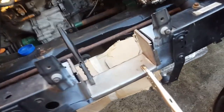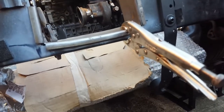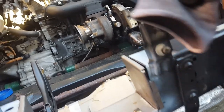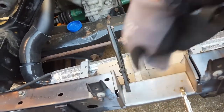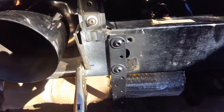After lots of cutting, shaping and mucking about I've got that shape. At the bottom it's pretty much there, needs a bit of bashing about, and then I'm just gonna get a jack in here and spread it apart, then weld it at the top and on the sides. Once that's done, the next thing is to build the bit that comes off here, goes across and down again just to give it a bit of rigidity. The top bit has now been built — just a bit of strap that'll be welded in place, which will protect the bumper to a degree and brace the crash bar.